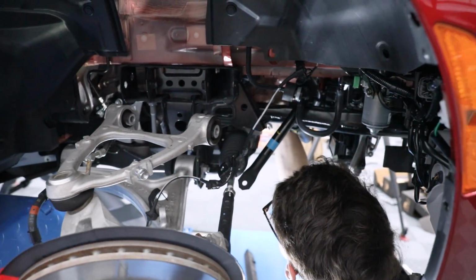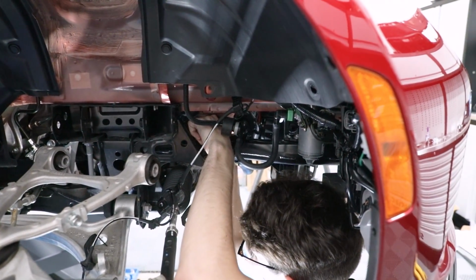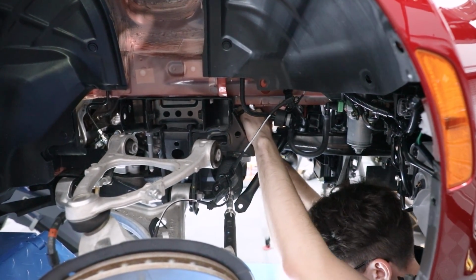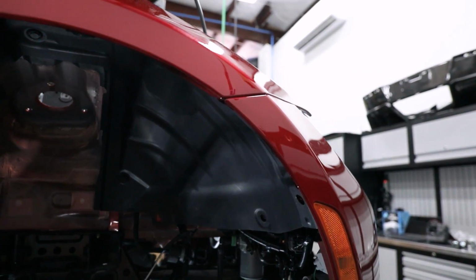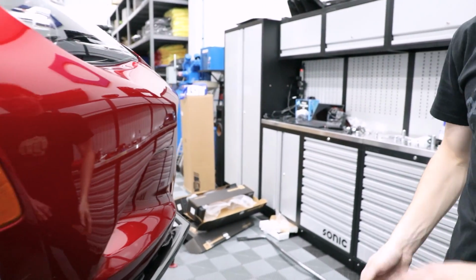Try to work the bar in front of the tie rod on the passenger side. Turning the steering wheel all the way to the right will help. The end should be pointed straight down. Not easy. This is a blood hand area. Okay, so we're taking the entire radiator out, or the fan out. Radiator and fan assembly out of the car.